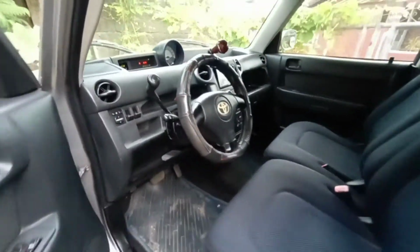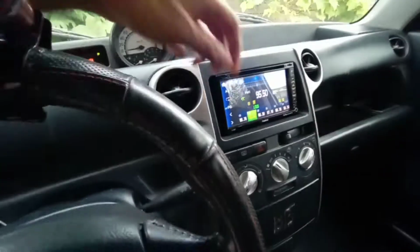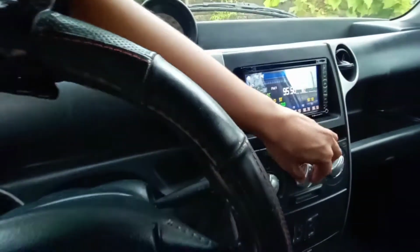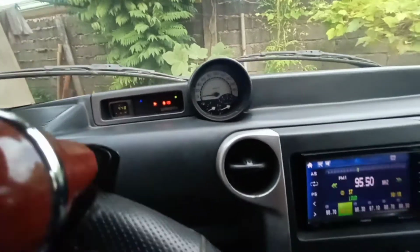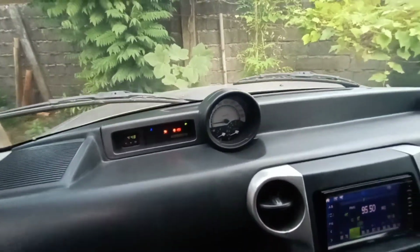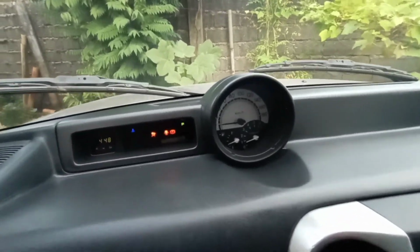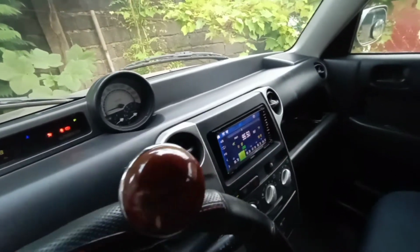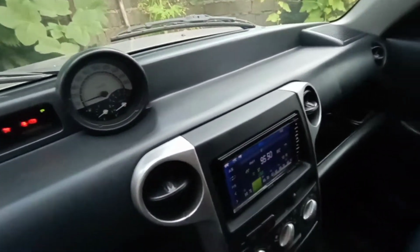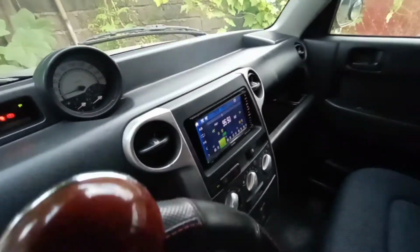So what you do is turn on your car, switch on the engine. When it's warmed up, or when the RPM idles, turn the fan on, not in the maximum setting, just enough. Turn on the AC. By this, you could just help the air conditioner move. The compressor shall move, the shafting shall move, and all the oils and all the refrigerant will circulate, and it won't stagnate. By that, you can lubricate the O-ring, and then you will temporarily reduce the refrigerant leak.